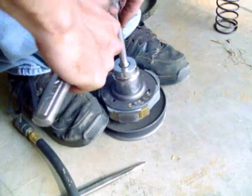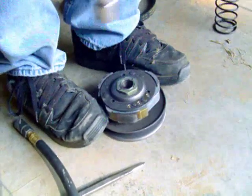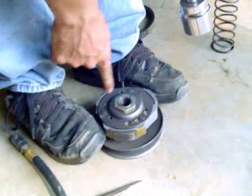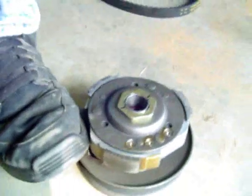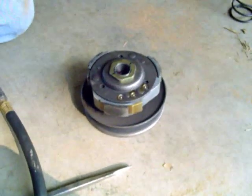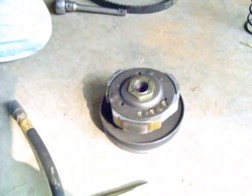I torque it as much as I can with a ratchet to get it about where it's got to go. You can see from the marks we're not really that far off. I'll get it as far as I can with the ratchet and then I'll take the impact wrench to finish it. You have to be extremely careful — that nut will ring real easily — so I'm using the impact on the lightest setting to get those marks lined up.